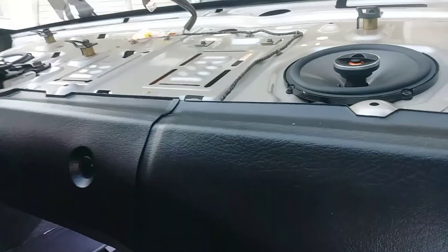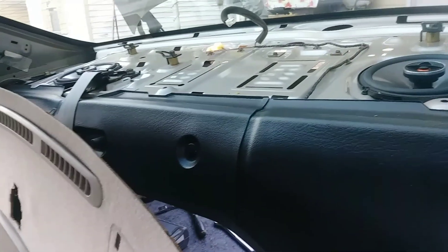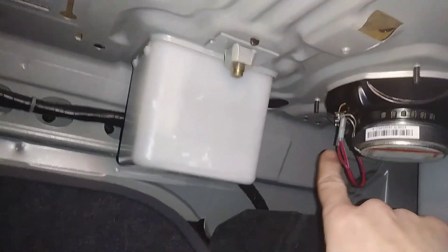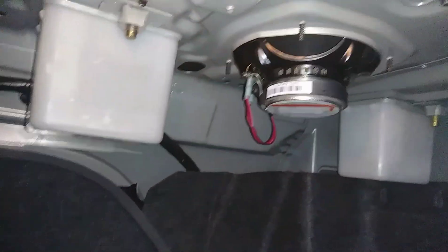So yeah, we have paper speakers. We're gonna put some proper aftermarket speakers in there. I'll pop those out and wire them up. Got them all buttoned in now — just gotta put it all back together. I had to extend the wires a little bit and turn these at an angle. I soldered the factory wires back there and crimped them in with clamp connectors — I've got a whole box of these. Done it right, and that's how it's gonna be.